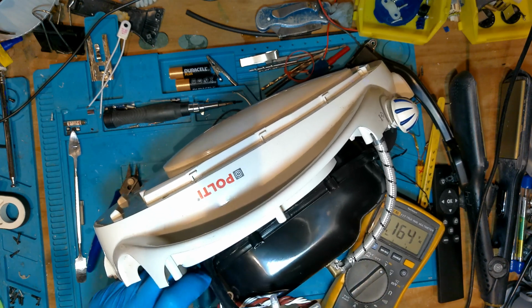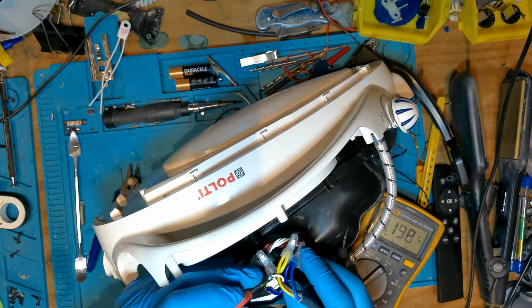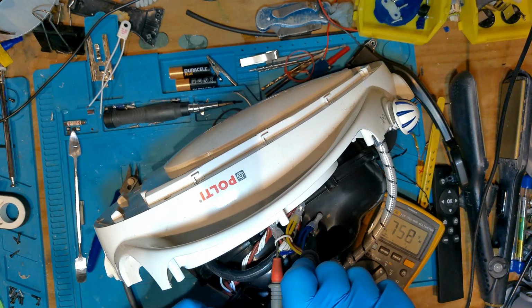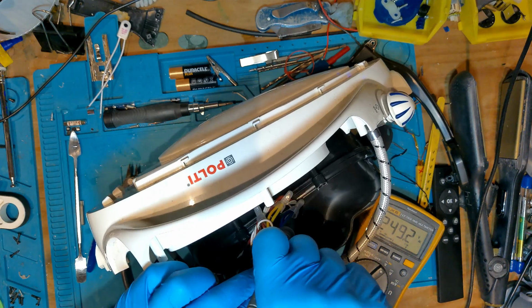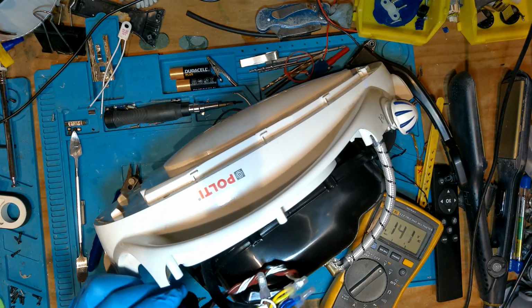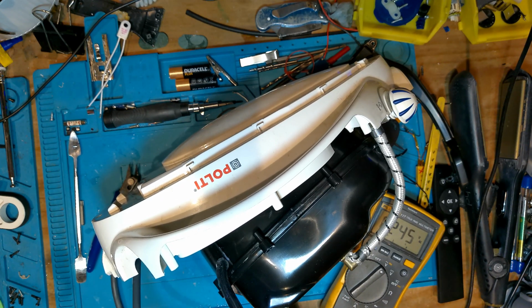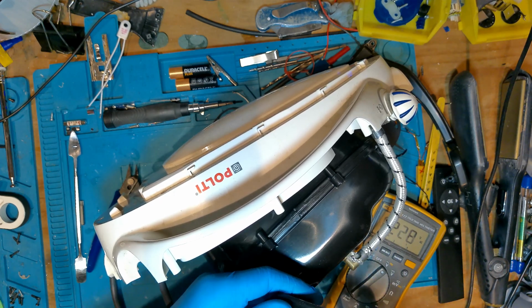You can't really see the multimeter display, but I've got my live and my neutral. Just a little bit hard getting into them connections, but as you can see, I've got 249 volts running through, so that cable's absolutely fine. It's allowing the voltage to pass through going into there. So yeah, although it's damaged visually, it's flattened, it's actually still getting power through. I am going to swap it and change it. So yeah, so power's going into it, so that's all fine.